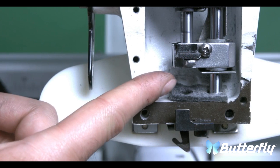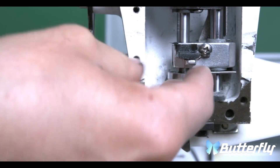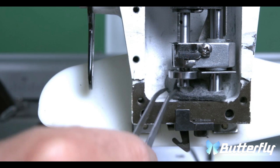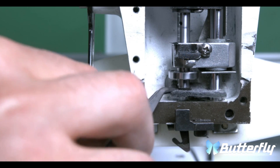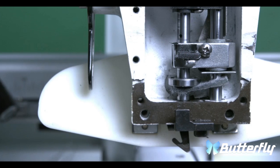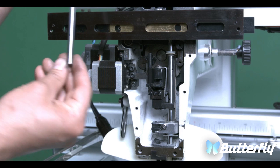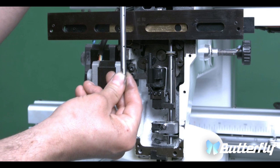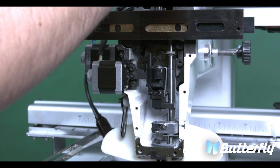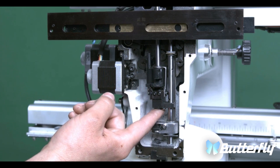After the center shaft passes this area, make sure to put the bearing to hold it in place, and pass the shaft through. You can use some tweezers to put the felt up through the center shaft and push through. This is another view of how to put the center shaft through the reciprocator. Remember that the shaft at the very bottom has a flat side that has to be facing to the left. Go ahead and put it through the reciprocator and slide it through.